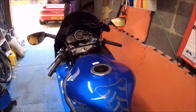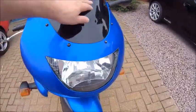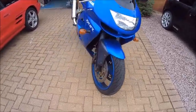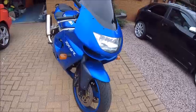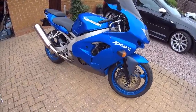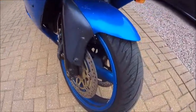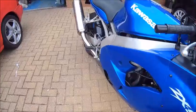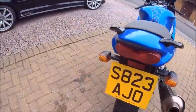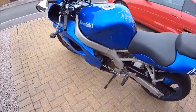There she is. I did give her a little bit of a tart up — washed a little bit of the screen and the front fairing — but she does need a good wash over now. The one thing I'm not going to use, because I'm dead against it on motorbikes, is a pressure washer. It's okay if they're absolutely caked up, like a motocross bike, but the trouble is with pressure washers you've got a lot of seals on motorbikes — seals on your wheels, bearings, everything else, your swinging arm — and if you're not careful you can blow the grease out and cause yourself more problems. So I'm gonna get a bucket, a sponge, lots of soap, and do it by hand.